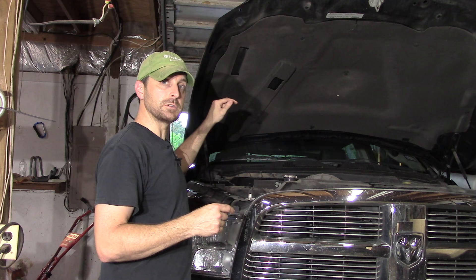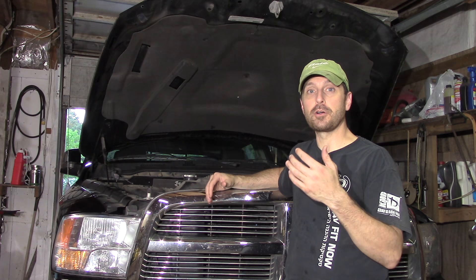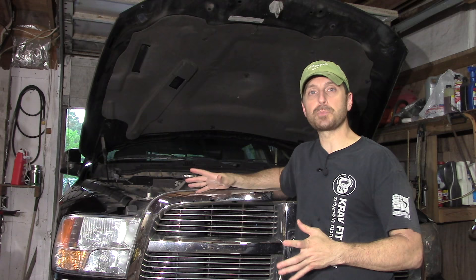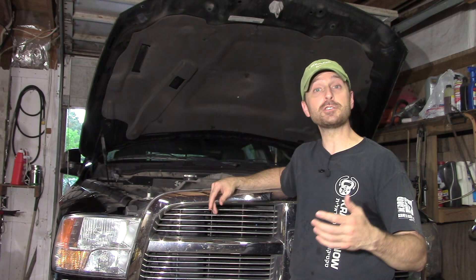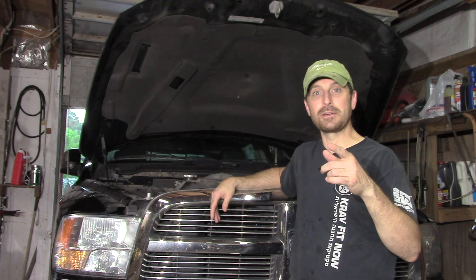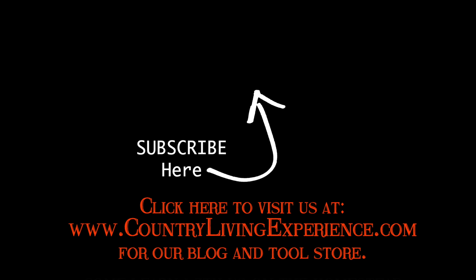On the Ram here, it is easier to get to that drain tube from inside and above in the engine bay than from below — it's just too far to reach your hand up in there and there's a lot in the way. So the best way is the way we showed you, down through the firewall just below that transmission dipstick. This applies to pretty much every vehicle — you're gonna have a tube that comes through your firewall on your passenger side. Some may vary, but just blow a little air in there and you'll be all set. Thanks everyone, and if you're interested we'd love to have you subscribe to the channel. Share this video with others, give it a thumbs up, and we will see you on the next video. Have a good one!